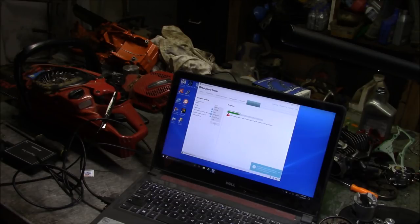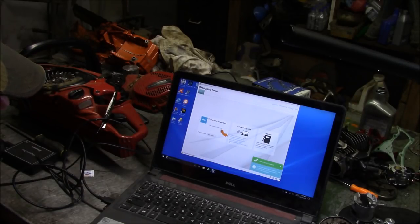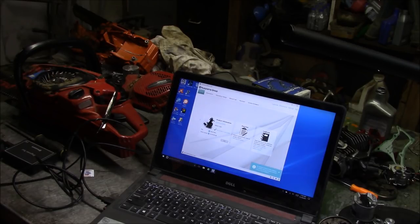This one is the CS 2258, which is identical. The thing is, they learn about their saws and actually tweak the timing, fuel curve, and mixture to make them run better over time. When you get a chance to have a dealer do a firmware update, it's usually worth it. The product is now up to date — that saw has gone through a firmware update.